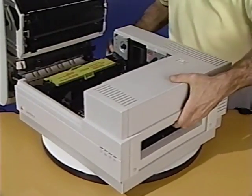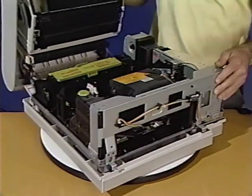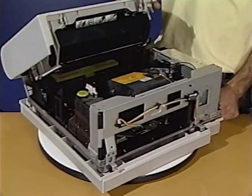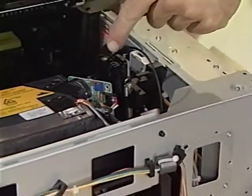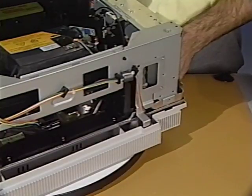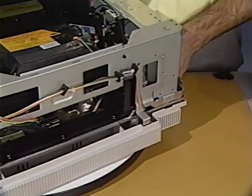Most of the parts are included in the laser scanner assembly and the toner cartridge. First, let's look at the laser scanner assembly. This assembly generates the laser beam that is reflected off the rotating hexagonal mirror onto the photosensitive drum. The laser and scanner assembly includes four parts. This is the fiber optic cable.